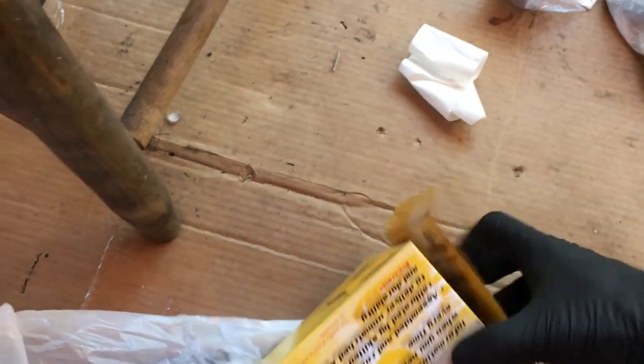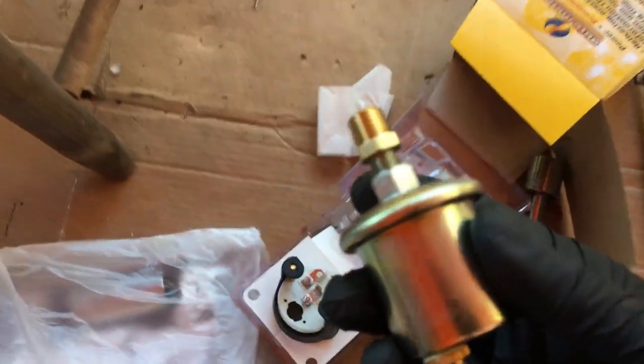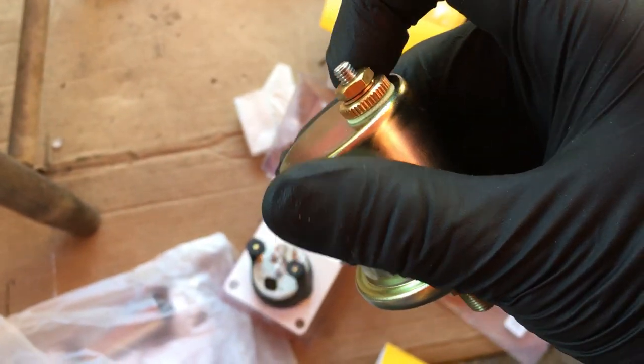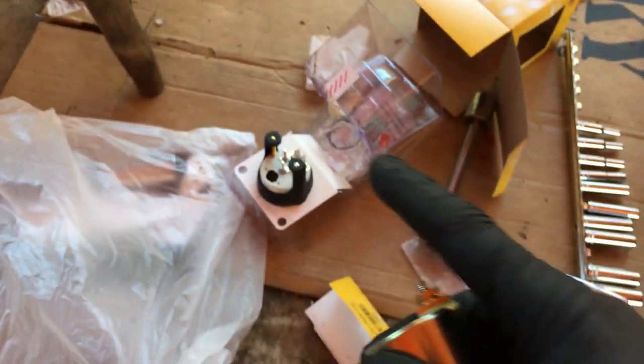All right, you can see — let's fit it in there now. The electrical oil pressure gauge comes with this little reader unit. What you do is you'll plug this in — it's an eighth-inch MPT — we'll get that fitted on there, screw it in, and then you'll plug in a wire on top of here and then run that into the back of your gauge.